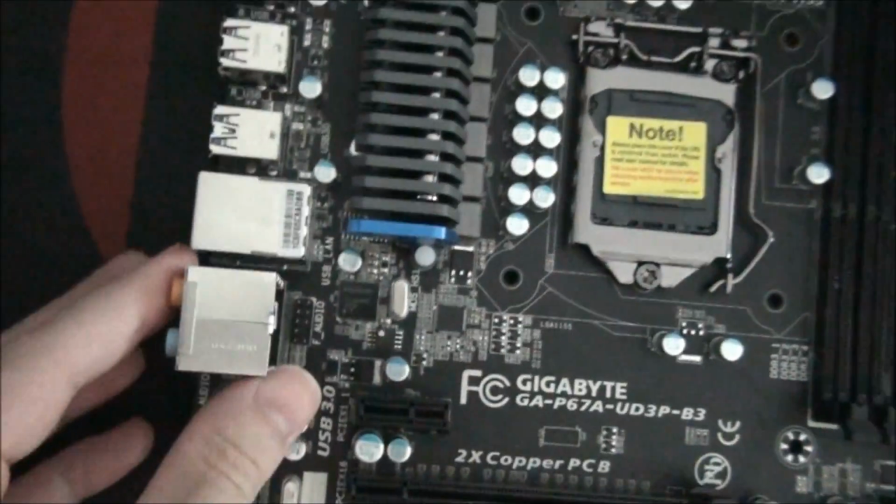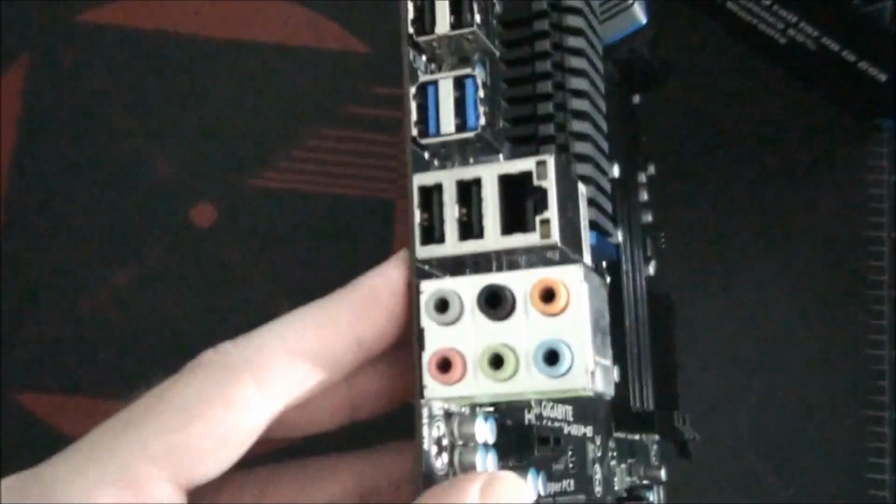and I know that because I've actually looked at the motherboard the right way up, and I've seen the back I/O panel, and I've seen where the holes need to be. So Matt's clipped it into position now. That's the way it goes. So now what you do is put the motherboard into position, push all the back I/O panel into where it needs to be, see which holes are lined up, pull the motherboard back out and put the standoffs in those holes.